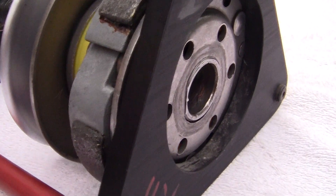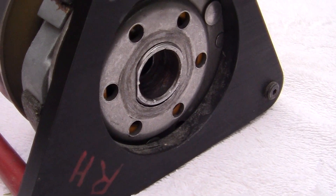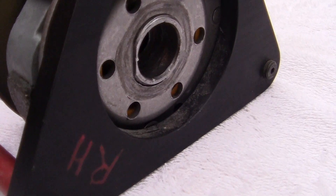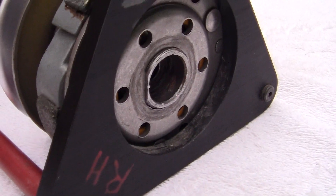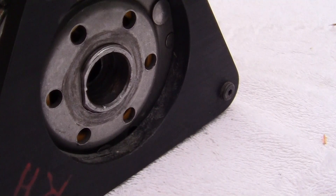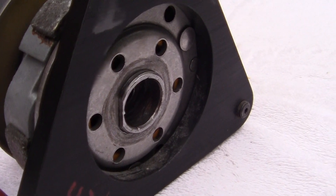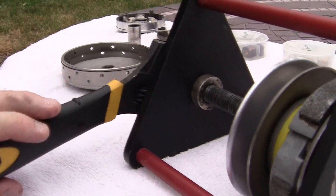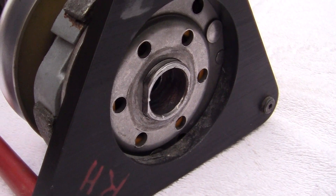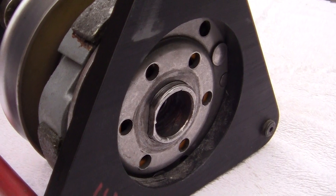All you want to do is get to where there is no more tension as I turn. That means that the clutch has bottomed out — a few more turns and the pulley will be seated with the clutch. Couple more turns I think. We're almost there.